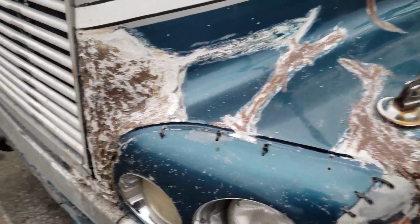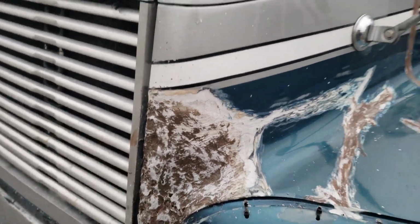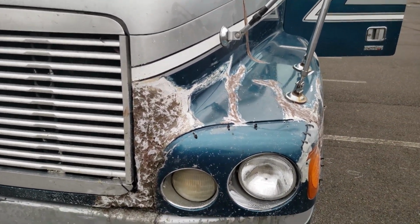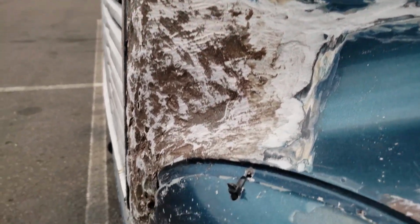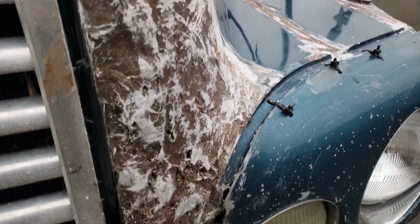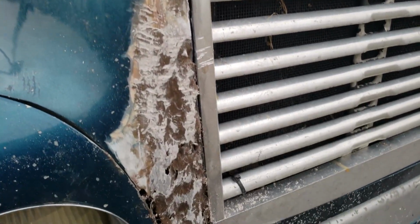Well, I'll tell you right now, I'm liking what I see. It's only been about 10 minutes of using the file. And as far as that originally having a huge hole in it, I'm really seeing this take shape right now. I got it smoothed out, nice and rounded. Took off the excessive areas. Now I have the surface prepped for the regular Bondo. Same thing on this side. And any of the edges here, I took out anything excessive.